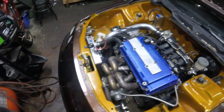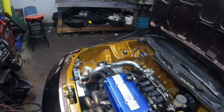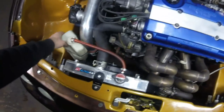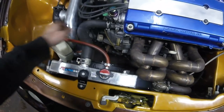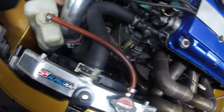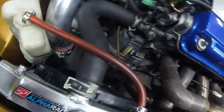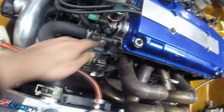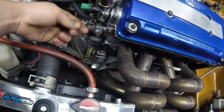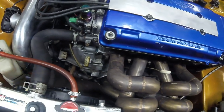This thing's a beast, guys. Honestly, this car turned out way better than I thought it was going to. The only issue is this head gasket leaked a little bit out of the corner. I don't visually see any oil from up here from a cam seal or anything like that — I think it's just the head gasket starting to leak a little bit.